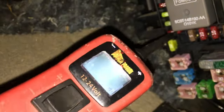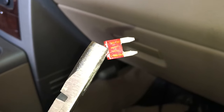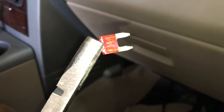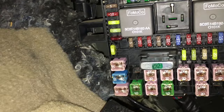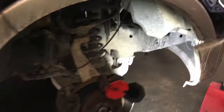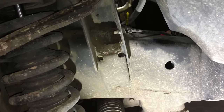Let's go ahead and pull that fuse out and see if it's burned. As you can see, looking inside the fuse, this fuse is burned. Let's go ahead and install another one. Now we have a freshly installed 10 amp fuse on fuse 11. Let's verify whether or not we have power at the connector for the compressor clutch — and we are now showing power at the connector. Let's go ahead and get a clutch installed.